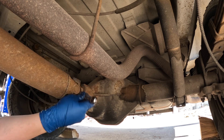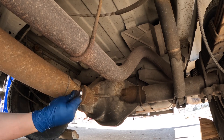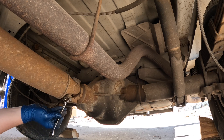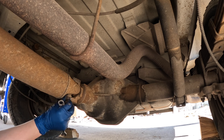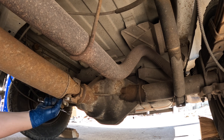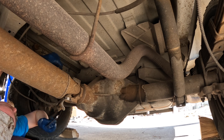Be aware that when you take the drive shaft out, the transmission park is no longer going to work, so I made sure to engage the parking brake fully and I also chocked the rear wheels. Also be aware that if you set the parking brake after putting the transmission in park, there may be a lot of tension on the parking pawl, which makes it tricky to get the drive shaft out of the yoke. What I did is drive forward a little bit, put the brake on, then put it in park and shut it off — so this should come out easy. The strap bolts are three-eighths. It's also a good idea to mark the drive shaft and yoke to avoid balancing issues.